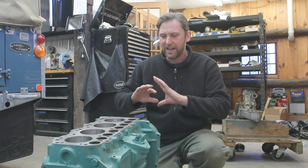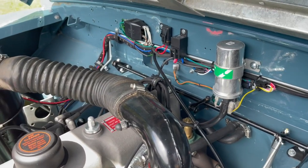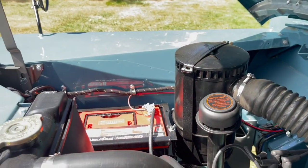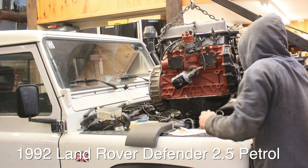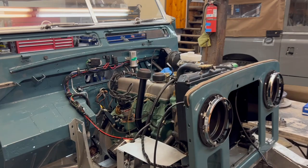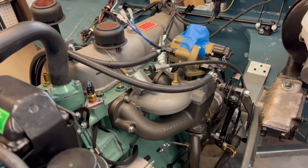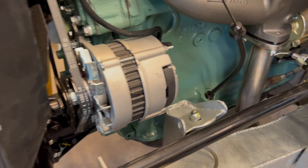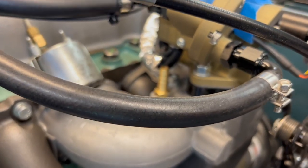Let's talk about the engine. I like to rebuild the original engine that came in the Land Rover if possible — I want to keep that engine with the Land Rover and just update it so it's viable on today's roads. These engines were basically available all the way up to the early 90s in Defenders. We put in a later 2.5 liter Defender cam, hardened valve seats, later style valve guides with umbrella seals, and a 75 amp alternator from a Defender. We're really building the engine to Defender specs, then going a little further with electronic fuel injection.